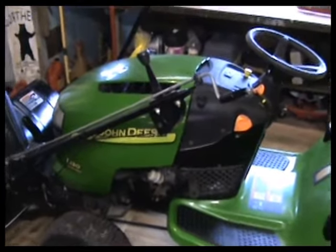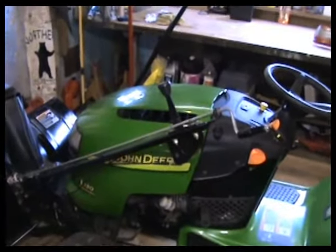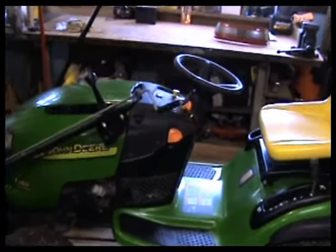As of right now we've got the John Deere available and our 10-horse Toro available. In full disclosure on our Toro float repair — we're very transparent here in the shop — after that sat for about two days it started to leak again. There was fuel in the float again, so we're going to call that a fail. There must be a small microscopic hole somewhere in that float. I went to the local Briggs and Stratton place and purchased a replacement for nine dollars, put it in, and it's been fine. For nine bucks, I probably should have just done that to begin with.